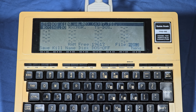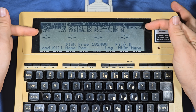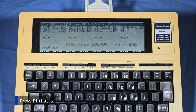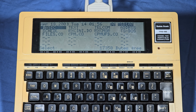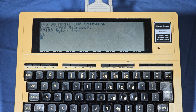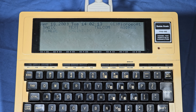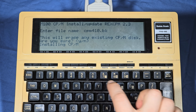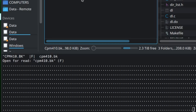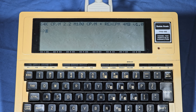Open the tsd100 program from the main menu. Press F4 to switch from the system files to the disk files. We will need to copy the cpmupd and cpm.co files to the system — press 1 and enter over each of them, leaving the file name blank to use the original name. After they're copied you should be able to see them in the system files area now. Press F8 to get back to the main menu and we now need to do a preparation step. Enter BASIC again and run the command clear 0,60000 to wipe the area that CP/M needs. Now you can go back to the main menu and run the cpmupd program — it's time for the final Tandy portable disk drive transfer. Enter either cpm410.bk or the 210 version depending on which RECCPM you have. This will take some time to transfer, but once it's finished you are completely done and CP/M is installed.